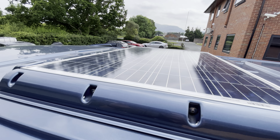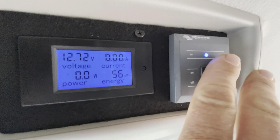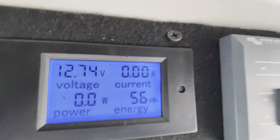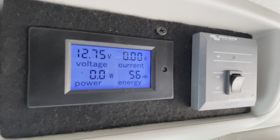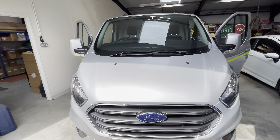It's the same system I've got on my own van. We've got a Victron 115-watt solar panel, and on my van that's linked into a display which tells me the current of the solar input. We've also fitted an inverter. It's quite overcast but you can see the van's leisure battery voltage is increasing now I've turned off the inverter — it's always being topped up by the sun. 12.74, it'll go to 12.75 in a minute — there you go, it'll creep up nicely to 14 volts and once the leisure battery is full it'll flip over to maintain the van battery as well. Thanks for watching!